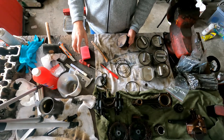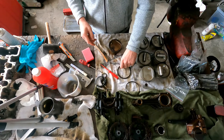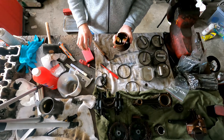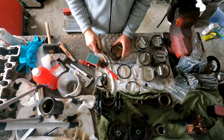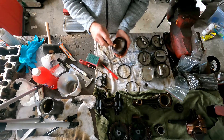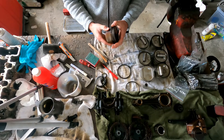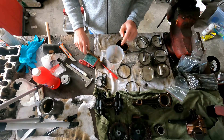Okay, so with the rings removed, I'll always use a brush like this — it's a brass material so it's pretty soft, not like a steel one, otherwise you'd scratch everything since it's still an aluminium piston. You can use a little sponge or another soft brush afterwards. What I do is get most of the carbon off first to loosen it, so the ammonia doesn't have to do as much work.